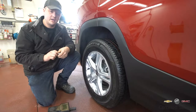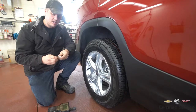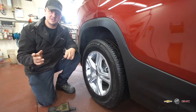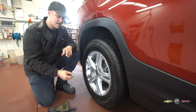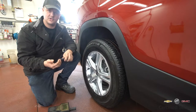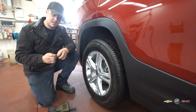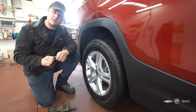If your tire light is on because of a fault or one of these sensors isn't reading correctly, it will show you that on your dash. These sensors do have a lifespan because there is a battery internal to them. The old sensors were live all the time and transmitted a signal to the module 24/7. The new sensors are smarter — they only check when the wheel is rotating. Once the vehicle comes to rest and the sensors haven't moved for a certain period of time, whether five or ten minutes, they'll actually go to sleep to save battery life. If you have any lights come on or any malfunctions, just come down and see us and we'll be happy to look after that for you.